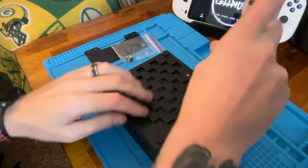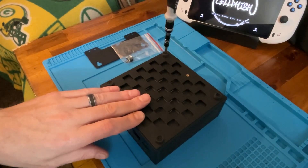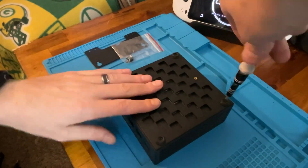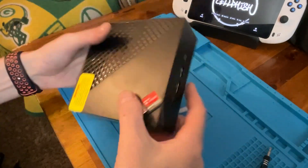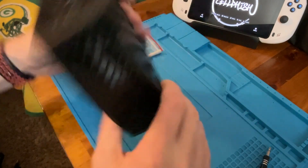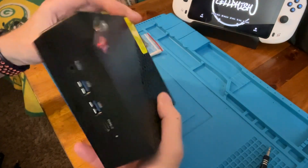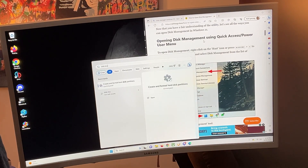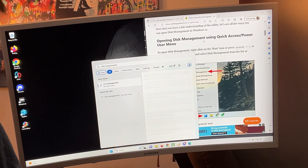On the real, don't over-tighten — tighten all these screws down and then go back a quarter turn just to make sure you're not cracking any plastic. Once you know everything fits together good and tight, exactly the way it felt before you took it all apart, it's time to plug this back into power and to your monitor. If you did everything right it should just boot right up like it did before we put this hard drive in.